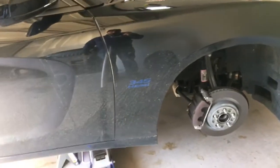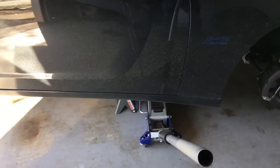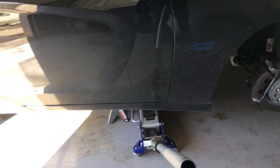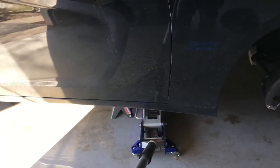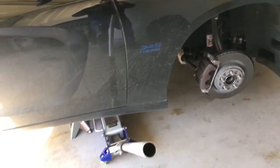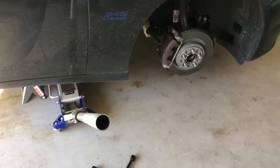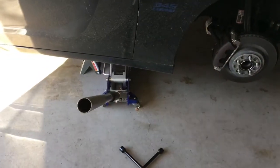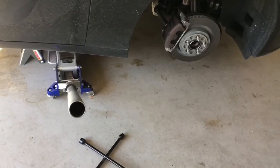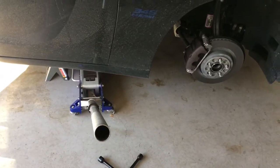The other side is off — the car is very, very dirty. One thing I always do is leave the jack still jacked up a little bit even though the jack stand is in place. It's always nice to have that extra safety when working underneath your car. I usually also put the tires underneath the car in case the car decides to slide off the jack stands.